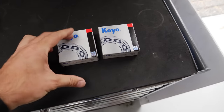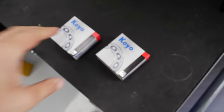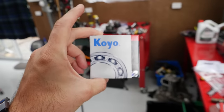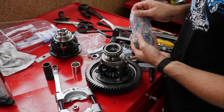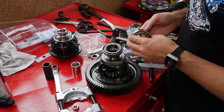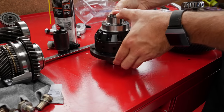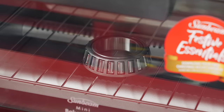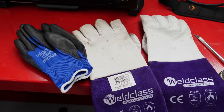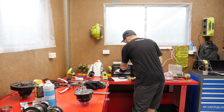There are two bits of excellent news. One is that I have the bearings - they have arrived and they look like the right ones, which is awesome. The second is that it's daytime again. The next step is to attempt to get these bearings onto the new diff. There's a bunch of possible ways to install diffs and bearings. The number one most successful method being: get a pro to do it. But if you enjoy the learning experience and are prepared to head to the wreckers with your tail between your legs for a second go when you get it wrong, it can be great fun to do it yourself. The second method for installing bearings is to use heat - by heating up the bearing you expand it ever so slightly, which will allow it to slip over the shaft. This isn't a great idea on bearings that are pre-packed full of grease or have fragile rubber parts, but it's a tried and tested method from way back.